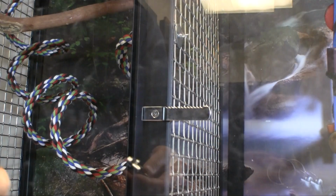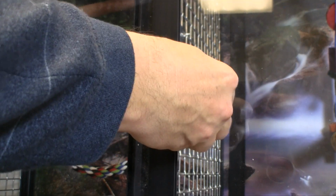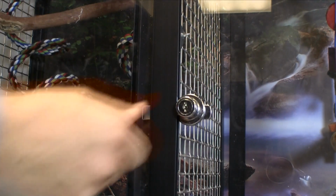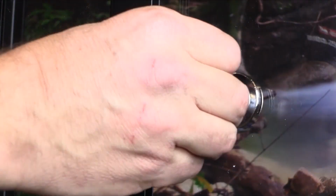Make sure that both doors are fully seated into the frames at the sides of the front panels. Rotate the key in the drum lock to open the lock. Insert the slide plate into the flat side of the drum lock and slide the lock over the serrated plate. Turn the key counterclockwise to secure the lock.